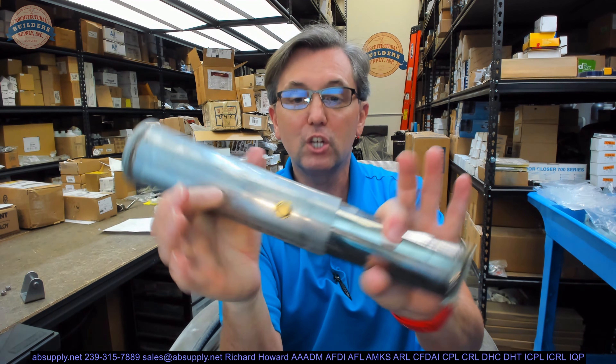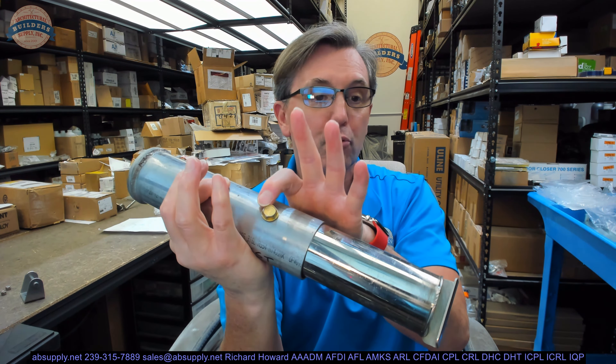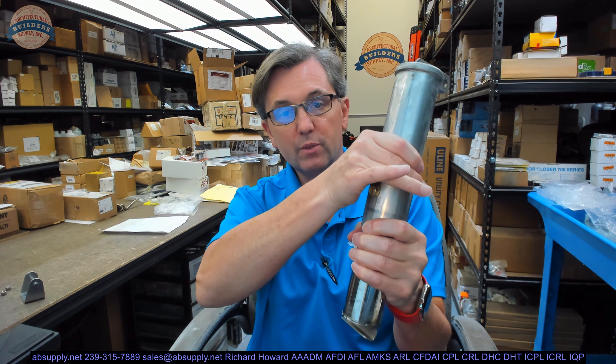I gave you the absolute overall dimension, but I can't say that helps much, because when they ship these they are pre-compressed. You get the door open to maybe 60 degrees or so, and that is how you install them. Clients will say their length is 15 inches — closed, 45 degrees, maximum open, maybe 80 degrees. I can't match up length because they all ship pre-compressed. When you swap these out, your lid will be in a partially open position so you can connect the two mounting points. You secure the lifting mechanism, then pull that bolt out — that is how you do the swap.